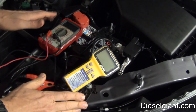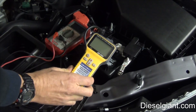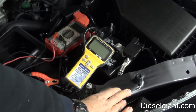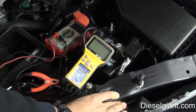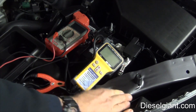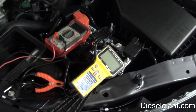I hope this video has given you better insight on battery testers. The digital voltmeter is always a good thing to have in your toolbox, but if you're having battery problems or want to check resistance, the conductance tester is what you need. When I went to buy two batteries for my diesel truck, I took the conductance tester to the auto parts store and tested three batteries — one had really high resistance so I chose the two with the lowest resistance. Even the store employees were impressed. Leave a comment with any suggestions for maintenance or automotive theory topics and I'll try to do a video on it.